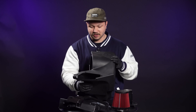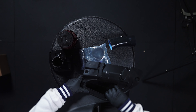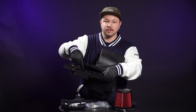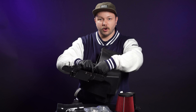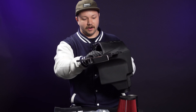The next piece is the section that attaches to your front bumper and then attaches here to the airbox — this is the inlet piece. The nice thing about this is that they've done away with some of the factory ribbing, which should smooth out the actual airflow path leading into the airbox. Additionally, they've been able to increase the inlet opening sizing by about 23%, thus allowing for more air into the airbox itself. The main focus here was increasing the smoothness of the airflow and the airflow velocity that this intake is able to house.